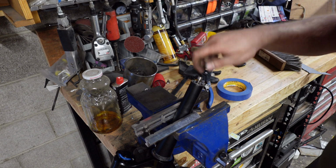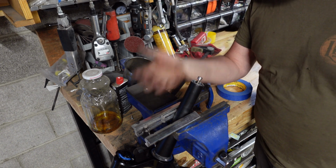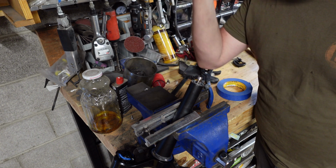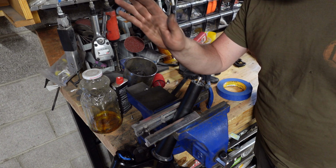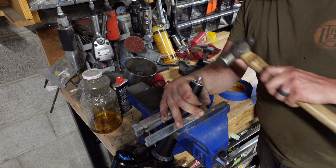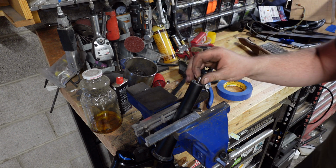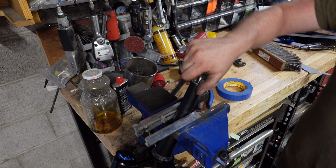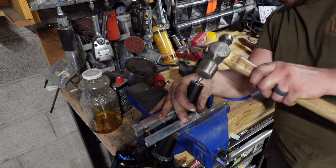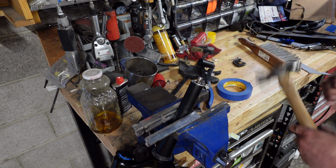And that's about right. Don't want to go too deep, and again, when in doubt, go to a bike shop, ask to use their star nut setter or have them do it. They'll charge you like $5–10, worth every penny. Unfortunately, I am at home and I want to get this video out and get this fork on for you. So if the shop's closed, you got to do what you got to do. There we go. Nice and square.